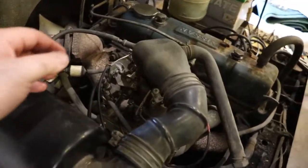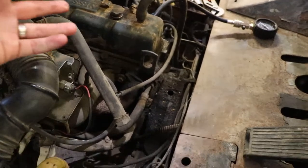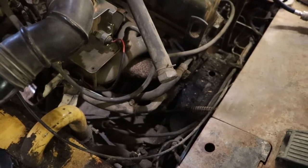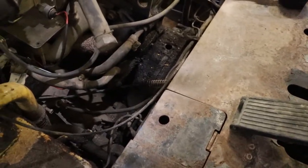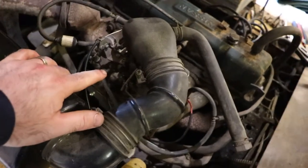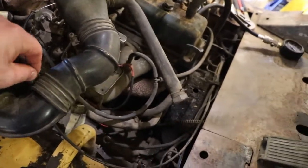We've got the carburetor back on. For some reason the previous owner disconnected the crankcase ventilation and just has a tube going to the ground, and they plugged the other pipe. I'm going to revisit that at some point — I've got to figure out if that's the PCV valve in there. I've also got the vacuum line hooked up, and I found that the two bodies of the carburetor were kind of loose, so I tightened those up.